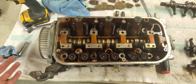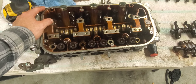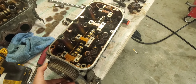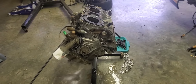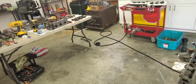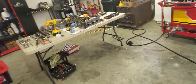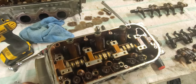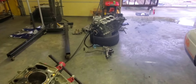Lucky for me, I've got some J35A8 cams. They are not here, but they are at my other shop. I'm going to get them, and I'm going to piece together a head with some RL cams and use that as a backup motor. Didn't really know what I was going to do with them - now I know. So stay tuned for that. Once I get those heads built and everything ready, we'll throw it on that engine and go from there. Both camshafts are shot, and I have to disassemble all four heads to make two good heads. It's either a whole lot of work to do that, or I just drop the RL cams in it and go through the whole thing. A lot of work to do, but unfortunately that's the direction we're going to have to go if we're going to stay competitive and stay reliable. Thank you all for watching - until next time, have a good one.